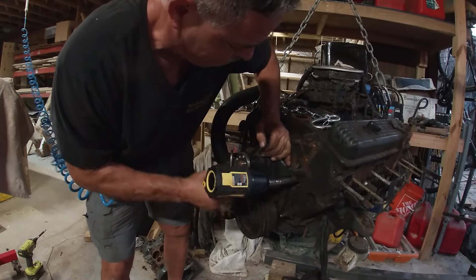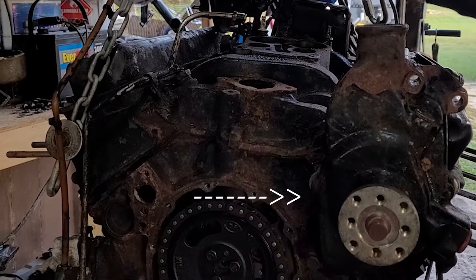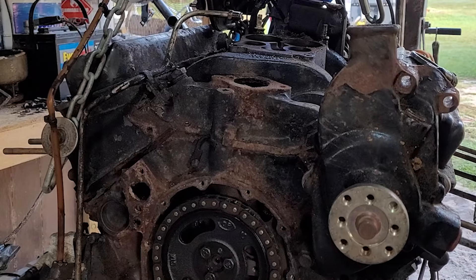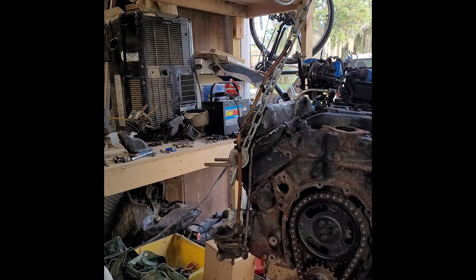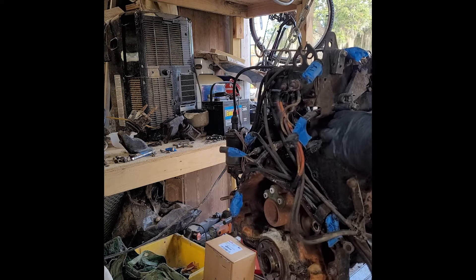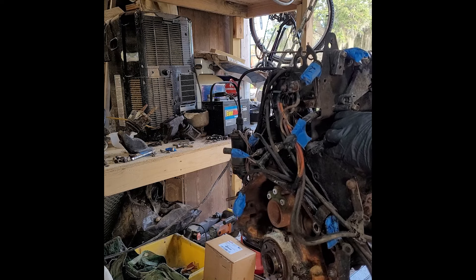So guys, as you can see I had one bolt here that I couldn't get out. I turned the water pump upward and eventually, once I got everything off the front, I spun the entire pump counter-clockwise until I loosened it and then I was able to get it off. I didn't realize the camera was not on what I was doing — I'm pulling off the valve covers. It's pretty simple on top: there's four long screws and I just unloosen them and then use a mallet to tap them off.